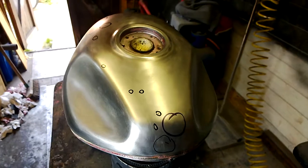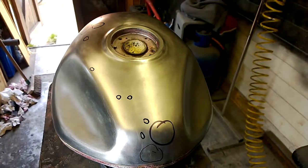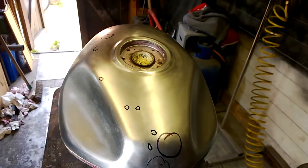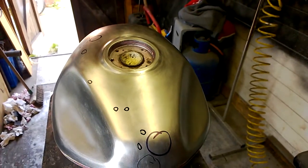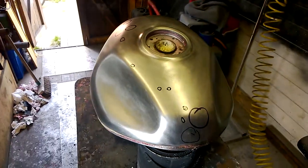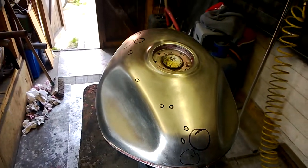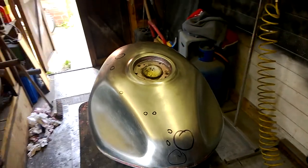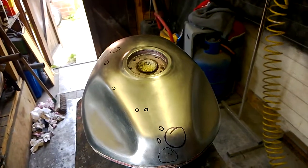After the silver shimmer is done, it'll get two to three coats of clear base. After the clear base is done, it'll go over with a bright blue candy. Once the blue candy is done, you need to do all your work at the same time with your candy, otherwise you'll end up with different density — some areas darker, some lighter — so be careful with that.